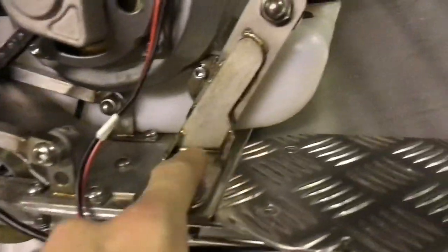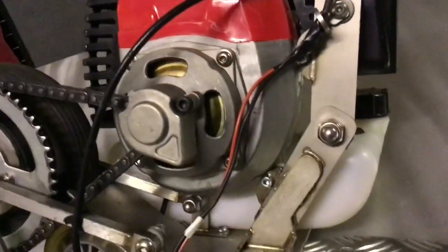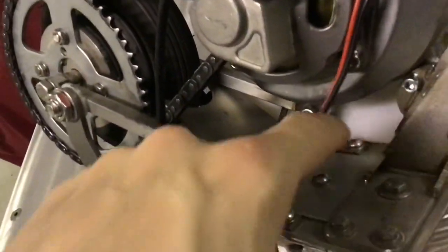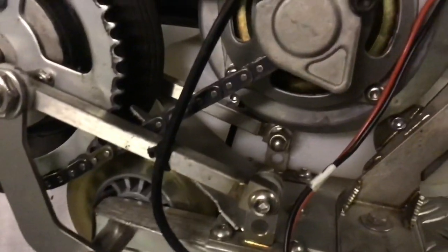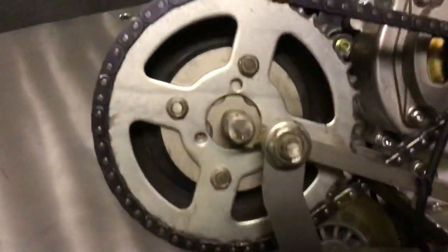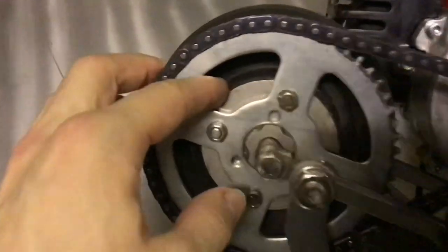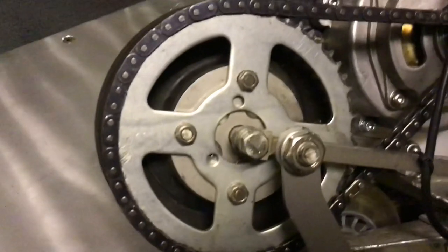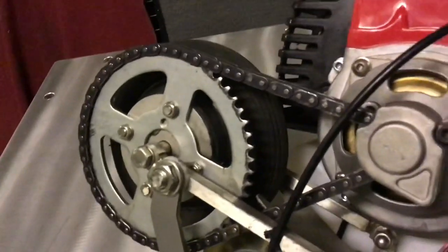This is the motor mount. It is made to fit the bolts on the aluminum housing of the motor. And then we have here behind some custom made aluminum mud flap or dust cover. And here behind we have, of course, the rear sprocket. This smaller round plate behind it is just an adapter or like a wheel spacer on a car, in order to change the bolt pattern. I had to make that to fit the sprocket on.